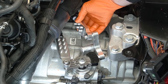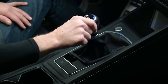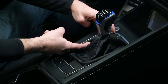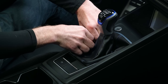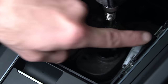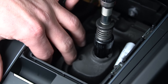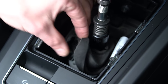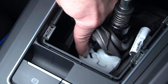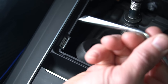This is basically ready to go, but before we can do anything with the remaining pieces we have to go inside the car. We need to remove our shifter boot — it's held in with a couple of clips. If you get right along the edge on the driver's side front you can really just pop it up pretty easily, no tools required. Here are the clips on the driver's side and here you can see where the boot clips in on the passenger side. When you pull that boot up you'll see this rubber piece right here — it's super fragile and if you look at it wrong it will rip. This piece is attached to the shift rod and there's a hole down here that's fixed with the shifter box — we need to get that aligned to set a base position.